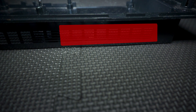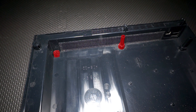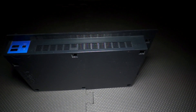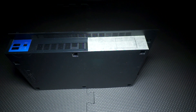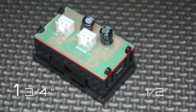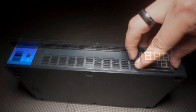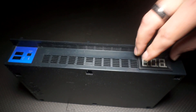You can mount the screen in this area without serious modification. I used the metal piece as a template to decide where mounting was possible. Again, you can mount the screen between these two posts. Now we will need to cut a hole, so I'm using the masking tape method, then I drew my cut. To decide how big to make the cut you will need to take a look at your LCD. For me it measured half an inch by one and three-fourths inch. Now the cut doesn't need to be perfect — the screen is made so it will hide your cut. Just make sure it fits nice and snug.